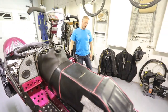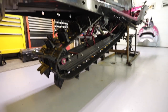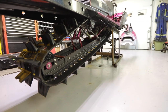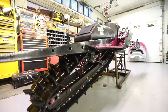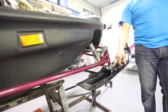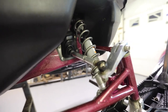It's still pretty light. The rear skid is carbon fiber — it has titanium bolts, aluminum cross shafts that have all been gun-drilled. It weighs just a little bit over 30 pounds and it's a 162 with a 3-inch, 16-wide track. These are chromoly trailing arms — a Polaris trailing arm put on a Ski-Doo snowmobile. I have aluminum Polaris spindles with Polaris skis.